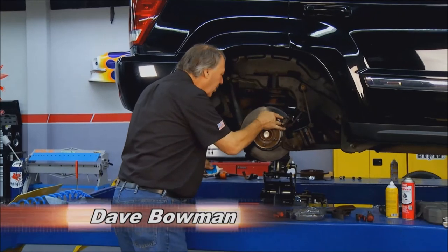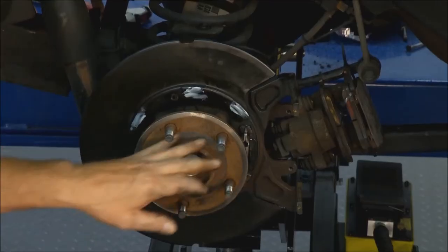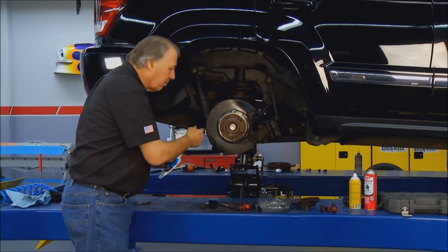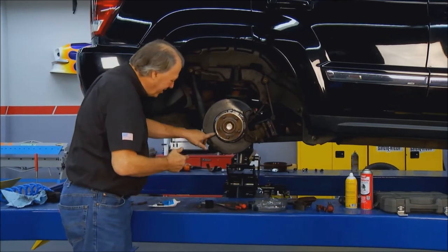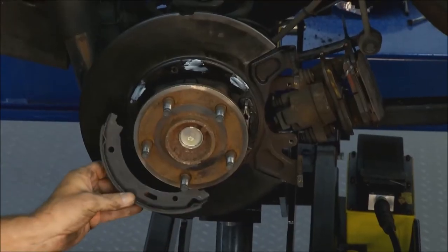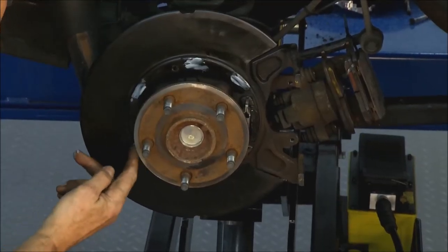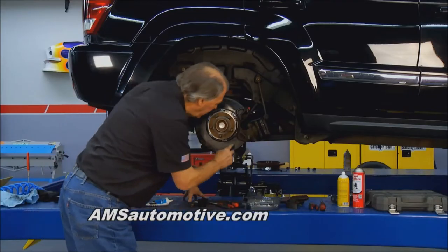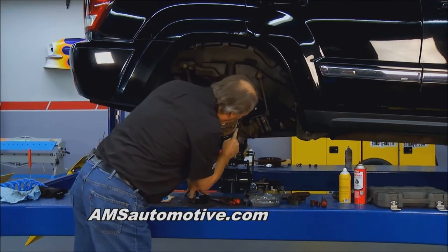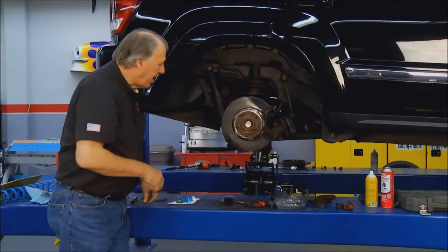Welcome back to Motorhead Garage. I've got the shoes off and I've cleaned up this backing plate — got that all nice and clean. We've cleaned off as much rust as we could and checked everything over. What I'm doing right now is lubricating my nibs. These are little places on the backing plate that extend a little bit, which allow the brake shoe to ride on them and keep it away from the backing plate. Take a little bit of high-temperature lube and put just a little bit on there — you don't have to put a lot. This will keep it from making much noise, help control rattle, and help it operate nice and smooth. I want to lube some of the other areas of the adjuster and put a little lubrication on that as well.